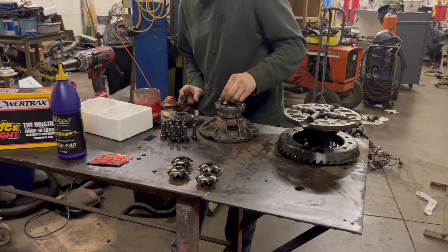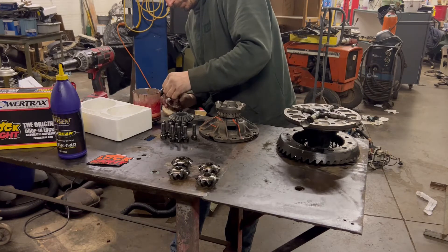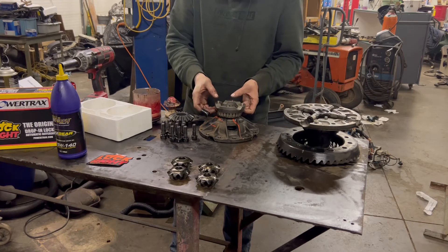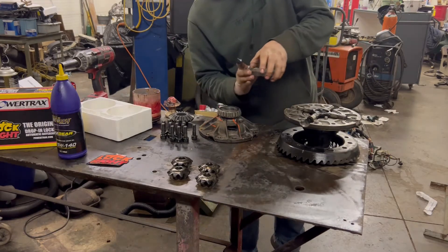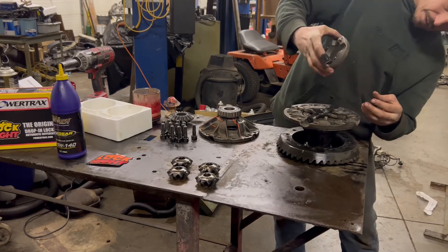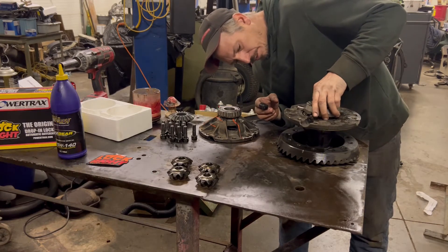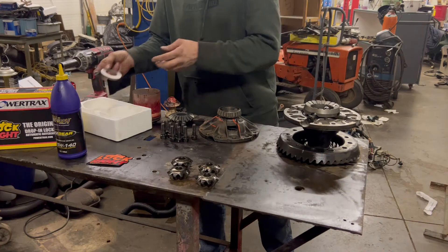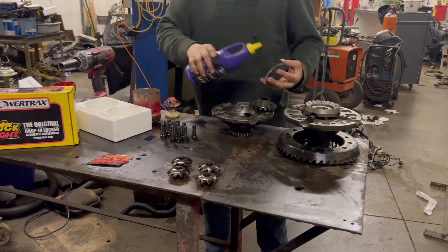Next pin, then springs. The grease is basically gluing that together so I can flip it over. Now we need to line a pin up with the spring from both ways. Make sure you're centered as possible, take your next thick washer, drop that in, and put a little oil on the back side as lubricant.